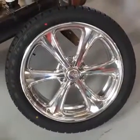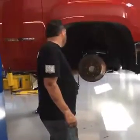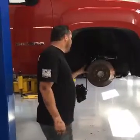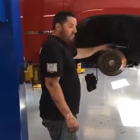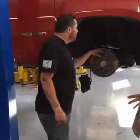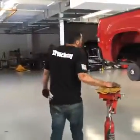Later tonight, maybe we'll do more Facebook Live, finishing up the rear. What's left on the front is what we showed. We bolt the brake line and the ABS line back on, bolt the caliper on, put the sway bar end links in, and put the tie rod on, and some grease and some cotter pins. And that's 100%. That's everything. All we did before we started was loosen everything up. So add 20 or 30 minutes to this corner and times it by about 4, and that is doing a kit. And we certainly weren't rushing. We were taking our time just to get everything done right. But I think Jeremy may do a little more Facebook Live towards the end of the rear install, maybe bolting the wheels on and then showing the stance and the final product when we're all finished.